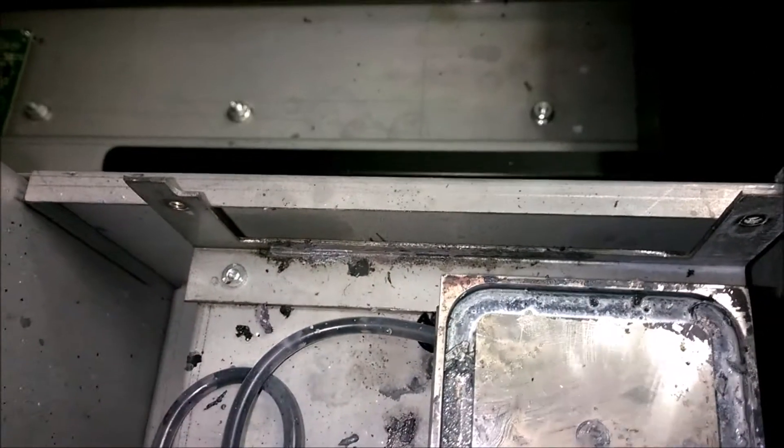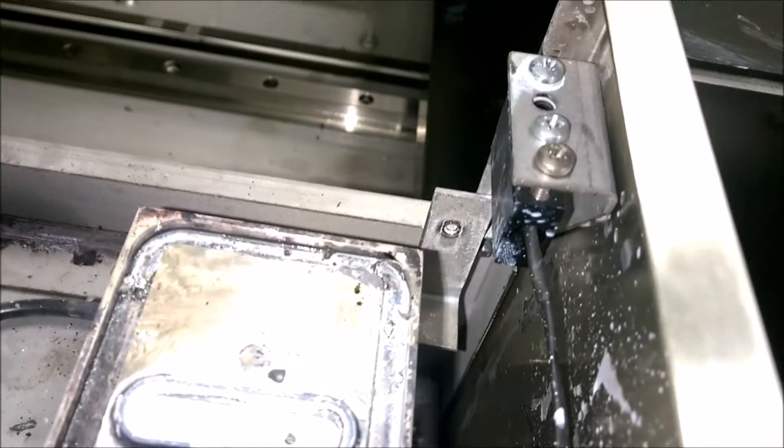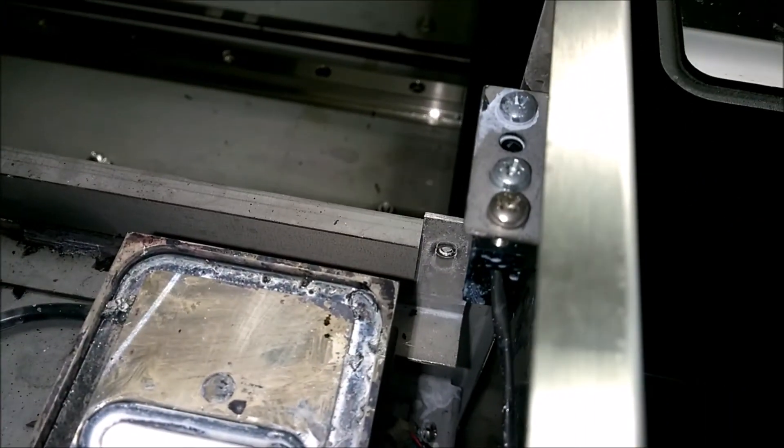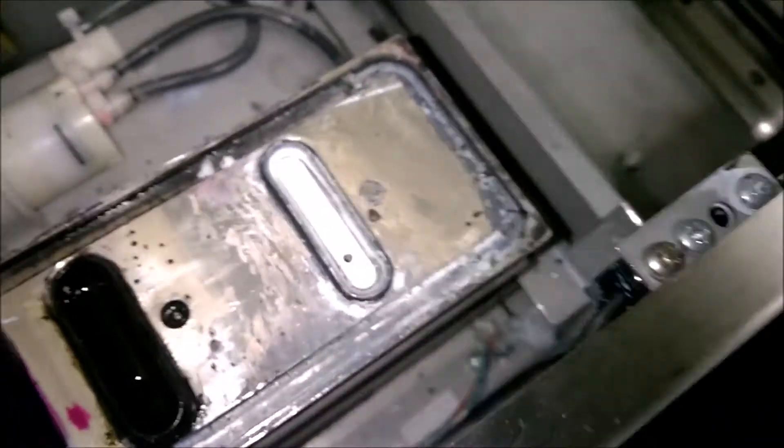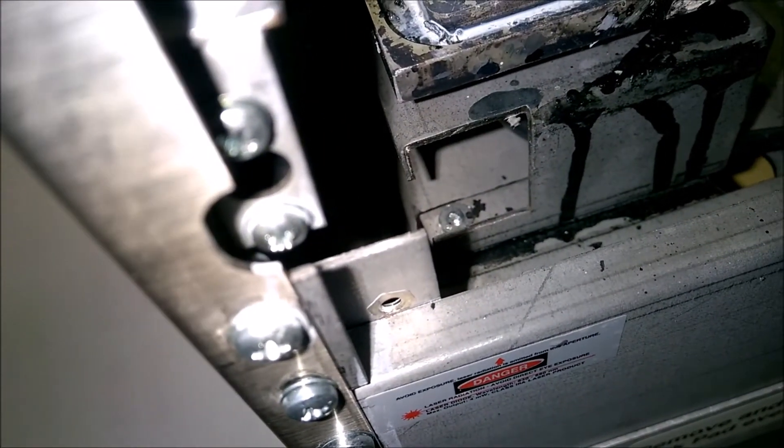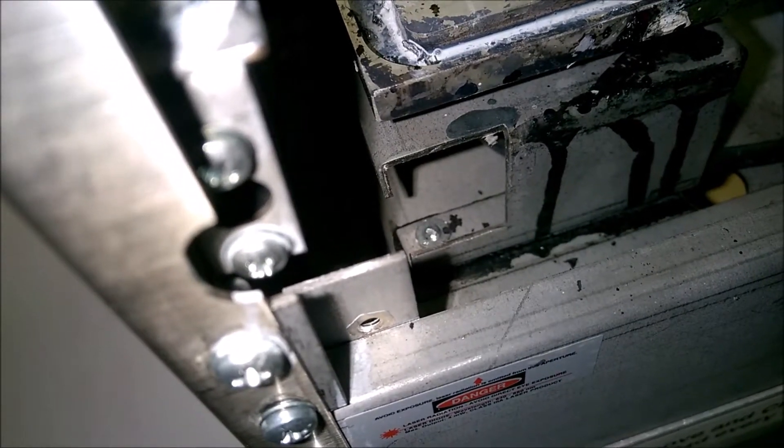Even though I'd wipe it, I didn't hardcore clean it. I've already taken it out of the machine — I'll show you where it was. It was an issue trying to get it out. There are a lot of little areas in there that you have to worry about not hurting. This is where the wiping maintenance station goes right here. You have two screws — one right there and one right here — which is a pain to get into this tiny little section. You've got to be careful not to hit the laser right here. And there's a little notch that the stepper motor has to sit in, which was also a little bit of a pain to get out.